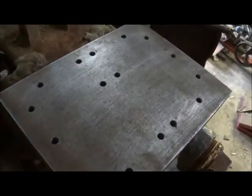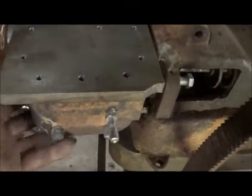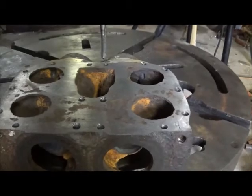We got our drill here - that's what we ended up with. We can actually look through our little holes here and see our little black sharpie marks, so we can get it lined up good. We'll get it back off the engine, get it lined up good, clamp it good, then go through these holes and mark every one of them. Then we'll get to drilling and tapping.